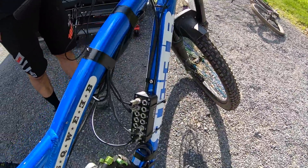Now that we've both taken our runs, let's have Matt give us an overall comparison. Looking at the app outputs for Jeff's fastest run and Jason's slowest, we can see a lot of differences. The first big takeaway is the flow score: Jeff's in the green with a 17.9, and Jason is in the red with a 36.6. That means Jason was braking a lot of times when he was going slowly, while Jeff was braking only when he really needed to slow down. In drag time, Jeff brakes for 48 seconds down a two-and-a-half-minute trail, which is actually a lot - but Jason brakes for 20 seconds more, almost 50% more than Jeff, putting him in the red.